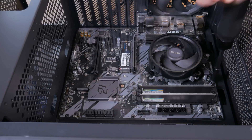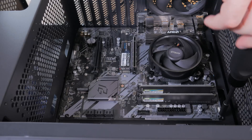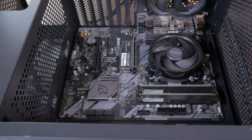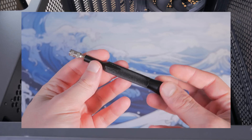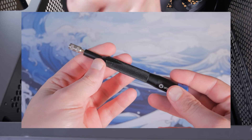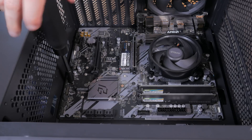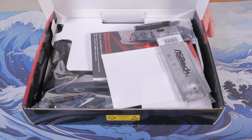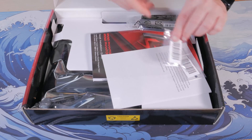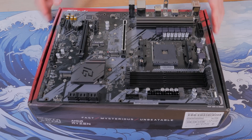I'm about to show you step by step how to assemble this system. To build this PC you'll need a standard screwdriver — preferably a magnetic one — a smaller screwdriver for the M.2 screw, and something to tighten down standoffs like a pair of pliers or ideally a nut driver. With all your parts and tools in hand, start by opening up your motherboard box and pull out the IO shield, an M.2 screw, and the board itself. Put the board on top of the box and grab out your CPU.